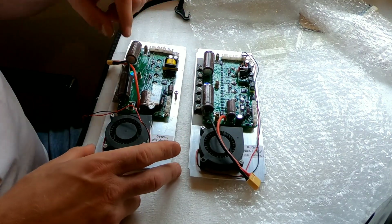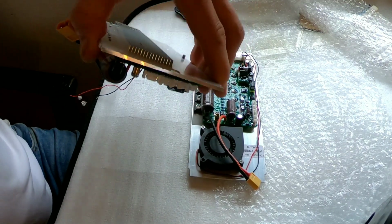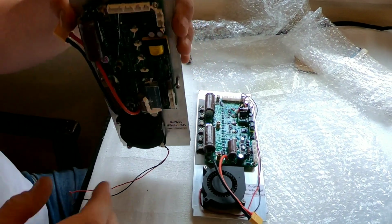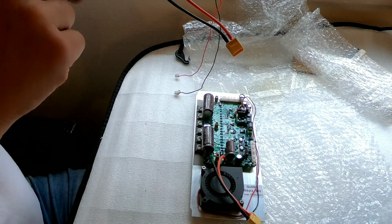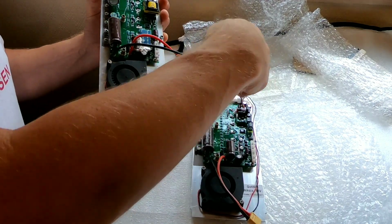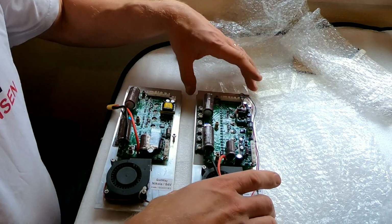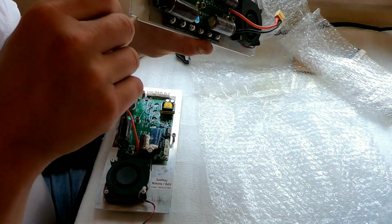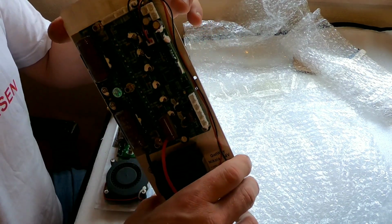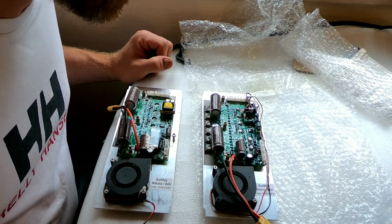And manufacturing wise, you probably won't be able to see anything here anyway. Yeah, a little bit. The first version of the boards used two strips of thermal pad behind each row of the MOSFETs. And apparently, at least someone thought that some adhesive would help in assembling this. New board, beefier MOSFETs, and you only use one large thermal pad, which should hopefully help with the assembly. Okay. Good stuff.